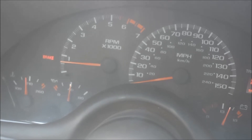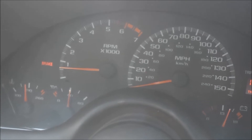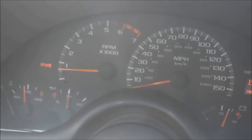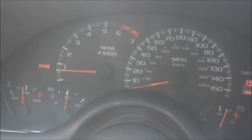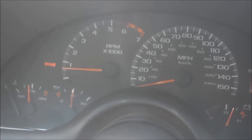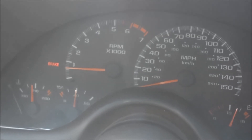I timed it for three minutes, and once the three minutes were up I'd go through the drive cycle. You need to do the cold start first. Part of the cycle is going up to 55 to 60 miles an hour for a few minutes, then slowing down to about 20 miles an hour. Drop it in D and then into 2. You can't have too much traffic or anyone tailgating you. Then you accelerate again — sometimes I'd punch it, though some drive cycles say half or three-quarter throttle — back up to 55-60.